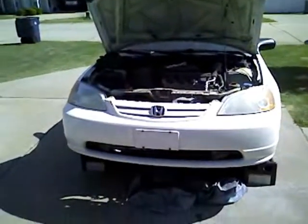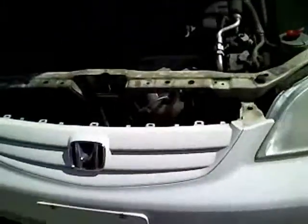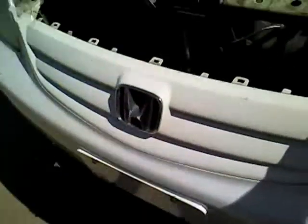That was a difficult job getting it out of there. The most difficult task was getting the right fan out. It allows you such a small space. Even with the motor mounts off the condenser, you only get just a little bit of give. Of course you can pull back the grill. The ideal situation would be taking off the whole grill, maybe even the bumper if you had extra time, but it's so flexible.